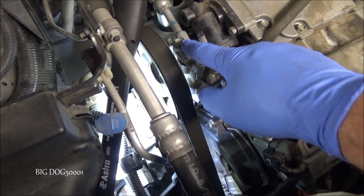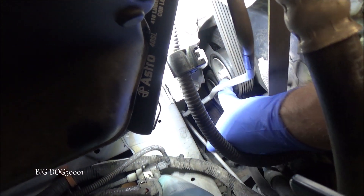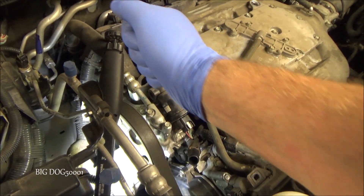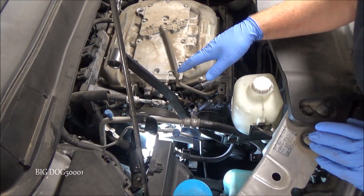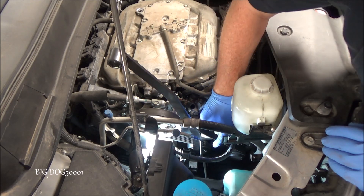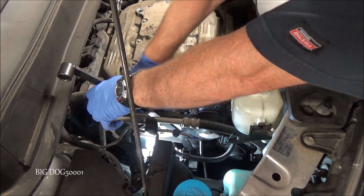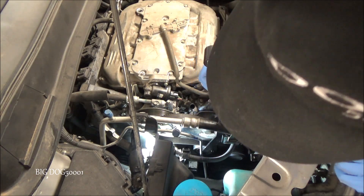Now we've got to get our belt off this power steering pulley. To do that, we need to put a long wrench or serpentine belt tool on our tensioner — that's a 14 millimeter nut. We need a wrench or serpentine belt tool long enough with a 14 millimeter end to put down there, then just push the wrench slowly to loosen tension on our belt so we can take it off. I'm just using a long serpentine belt tool made specifically to work on Hondas. All we've got to do is just gently push it forward — we don't want to go too fast — then slip the belt off the pulley. Release the tension nice and slow and that's it.